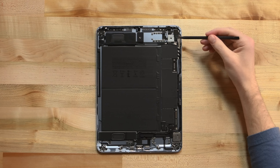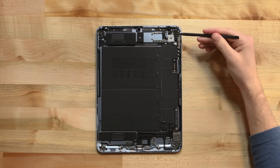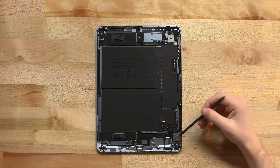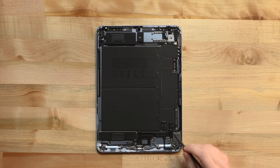The rear camera hardware lives up in the upper corner underneath the Touch ID hardware. Since we have Touch ID instead of Face ID, there's just a single 7-megapixel FaceTime camera for video calls and selfies. Toward the bottom of the iPad, there's a SIM reader in the cellular versions like ours, and unfortunately it looks like Apple hasn't changed the way they connect iPad batteries to logic boards — this is the same annoying contact hardware from past iPads.